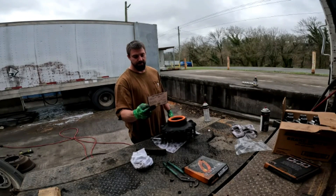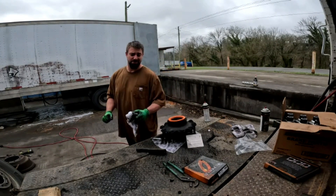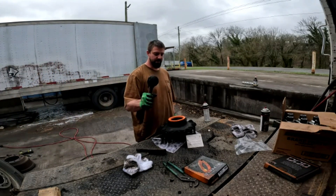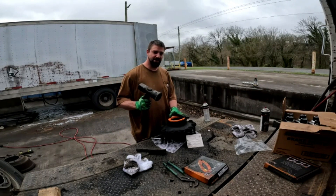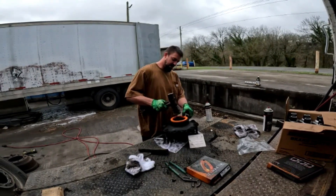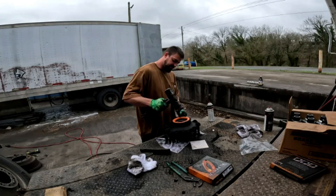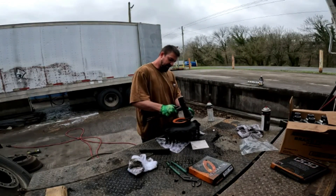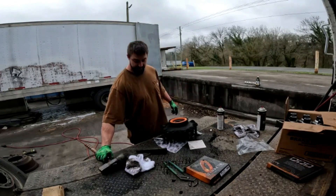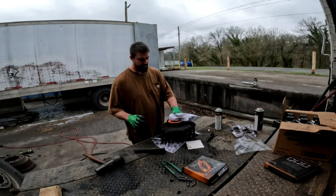Now to my favorite part. If installing by hammer, the instructions say: tap around the top of the seal in a circular motion until the seal has bottomed out. The instructions are awesome. What I use is one of my tire hammers — it's got a rubber end on it just for safety, so I'm using rubber to steel to the seal. Very forgiving. And that's why I'm quite the fan of the Rev HD wheel seal.